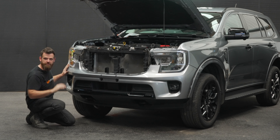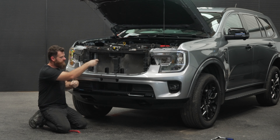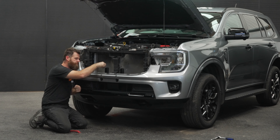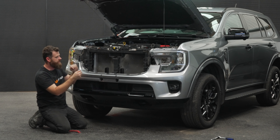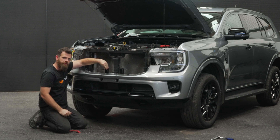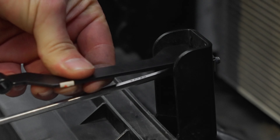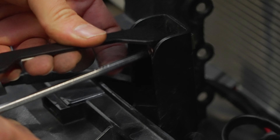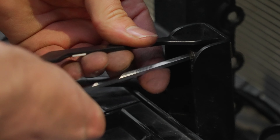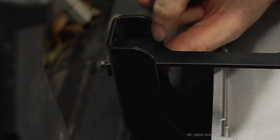The upright plates are there to help stabilize the rally bar once the weight's on it. The cage nuts will squeeze in — squeeze them really firmly and insert them into the back until they snap in. Then once the grille is back in place, put this plate through and a bolt through the opening in the grille and tighten that up on the cage nut. Get these just nipped up so they're firm but won't move easily. Then once you slip the grille on, put an allen key through and tighten them up so they're firm in place.